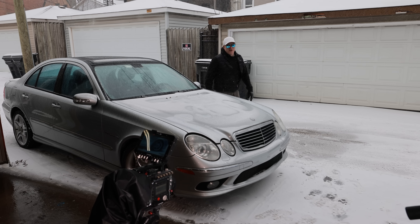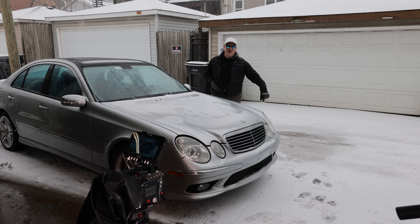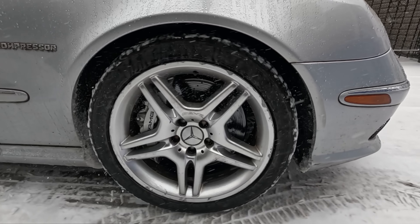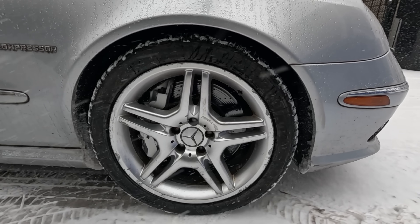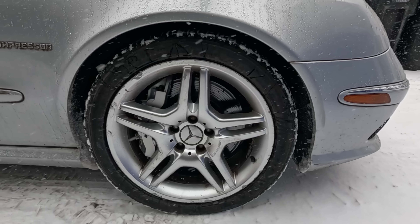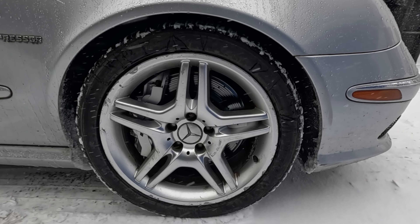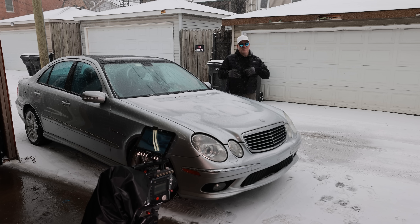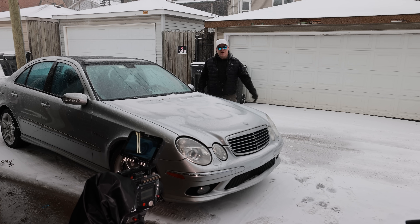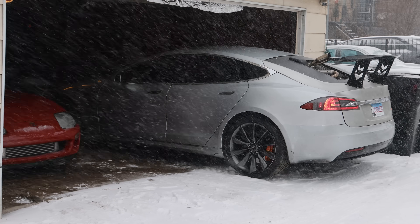Things are getting really interesting now because I thought the pulses were going to be faster on snow where I have less traction, but it seems like they're the same frequency as when the pavement is dry. To me it looks like somebody's just pumping the brakes, locking them up, letting up, and pumping again — sort of slowly. It's not as fast as I thought it was going to be. I think it depends on how much traction you have — maybe with a bit more traction the pulses are longer. Let's pull the Tesla out next.